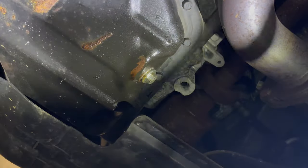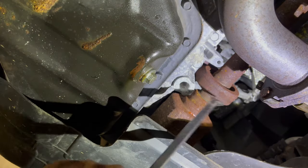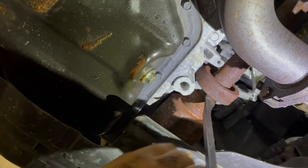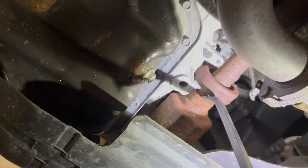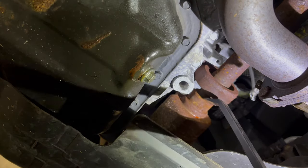Hopefully, I mean, I am not going to spend all day on this, either for your benefit or even my own. I have the axle out and I'm going to put my tool here or here, either way, and add a little force. There's a circlip that makes this bite in so it can't fall out, and you may have to support the axle from the other side to make sure that the weight isn't holding that together.